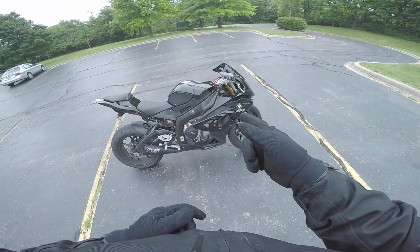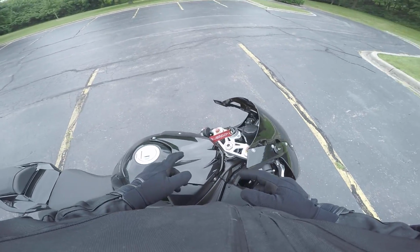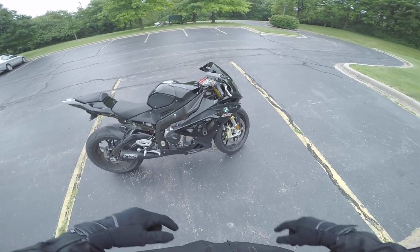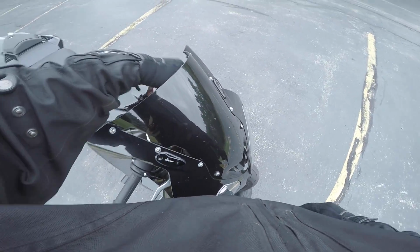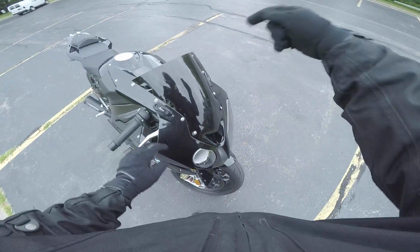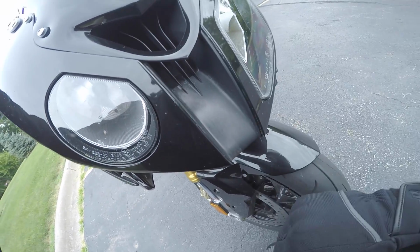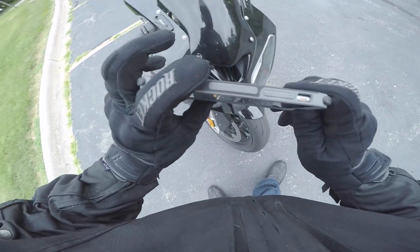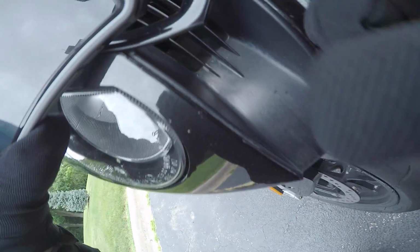I've also got a Sprint air filter in there from BrenTune, and they also send you a cable to reroute your intake air temperature sensor. So basically, you take this out, you take your dash out right there, you take this off, and you drill a little hole behind it, and it relocates your intake air temperature sensor right in there. Got my little handy dandy phone out. I don't know if you could see it, but it's right up in there.